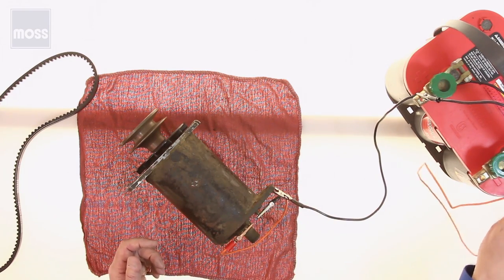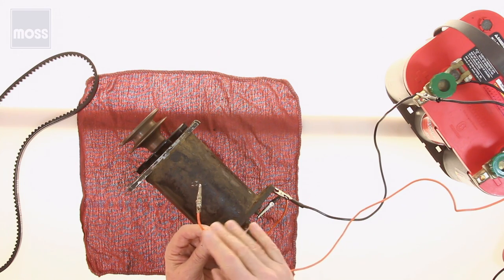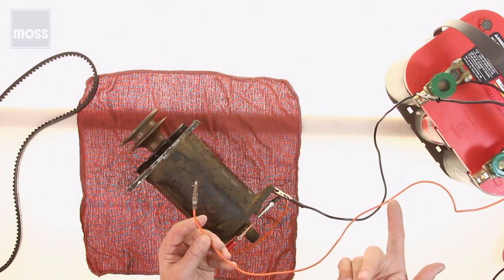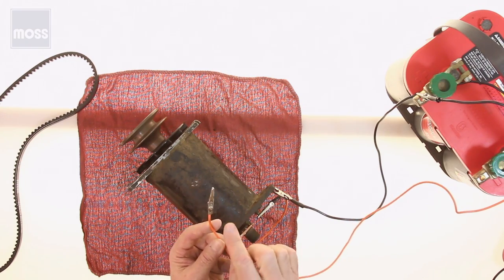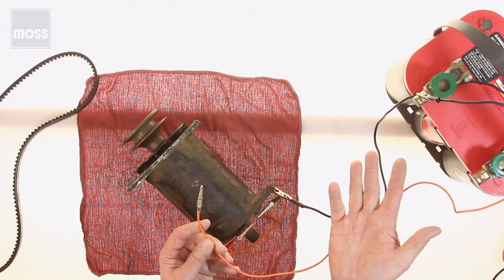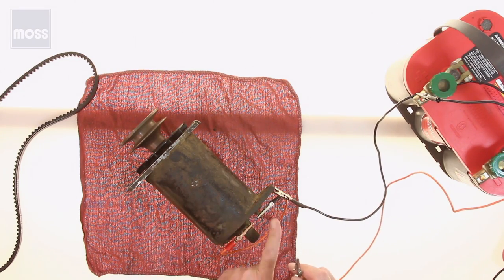And the last thing we need is another jumper lead. This jumper lead needs current. Now you're saying, well, where are we going to get the current? I'm coming off of the battery here because, again, I'm not working in your automobile. But in your automobile, you want the other end of this lead to go to the brown wire that feeds your voltage regulator. So here I am. I've got power because I'm connected to the brown wire. I've got my jumper here.